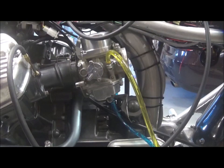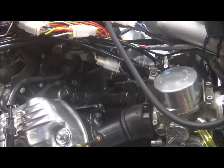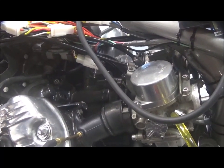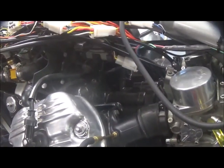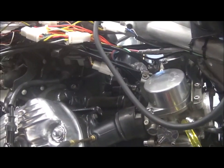I started to look at other possibilities. It was starting on the right cylinder but not the left. I tried swapping the power cables for the two coils, and when I did that I had nothing — it was turning over but it wasn't starting at all. I put it back and it was starting and running on the right cylinder only.